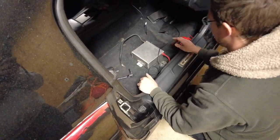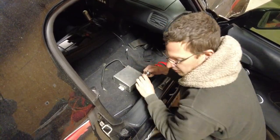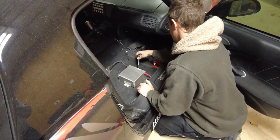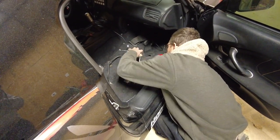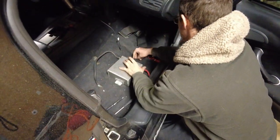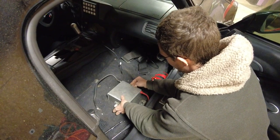I like this battery box — it's a cool little battery box but annoyingly placed being under the seat. This thing had a good run for a number of years with a lithium battery, and then it was cranking a little slow so we went back to an AGM — an ETX-14 standard East Penn manufactured AGM. We put it in fresh for Optima, got there, and it wouldn't start the car. It was pretty much bad right out of the box. We charged it up that night, next morning — nope. We had to jump start the car for the whole event and get it back on the trailer.